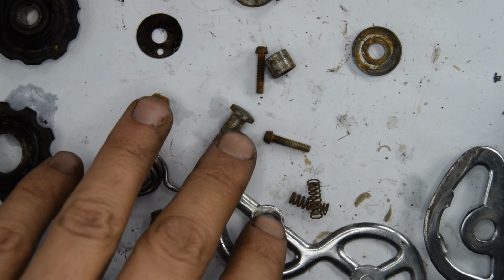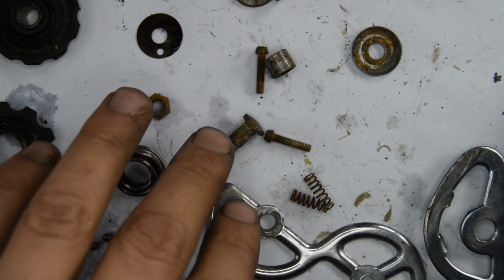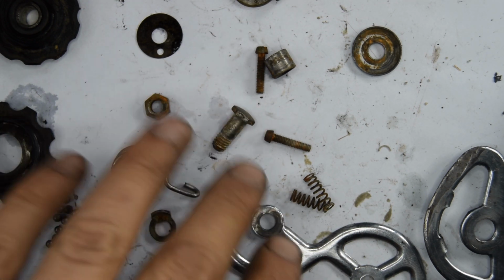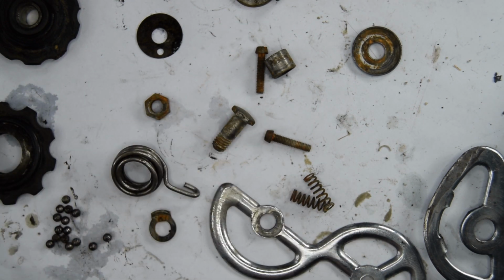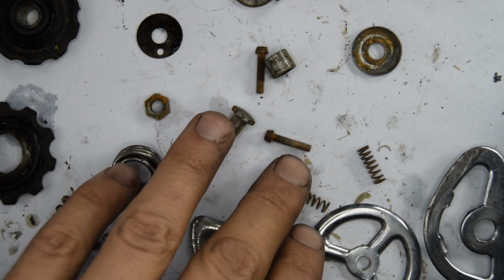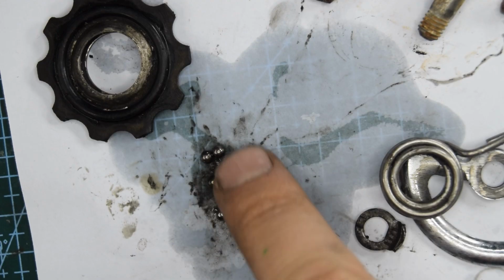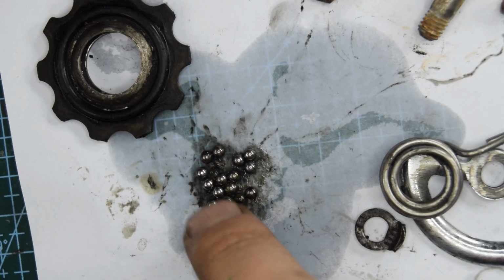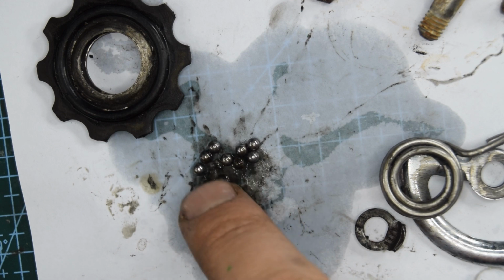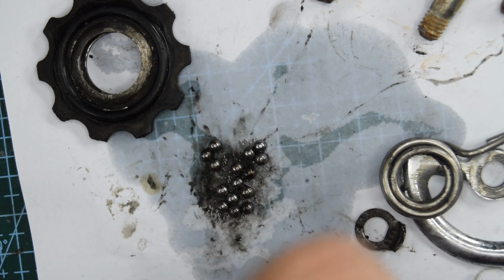All the parts have probably oxidized a little bit more now than they were initially, but that should be rectified. We're going to put a bit of grease on it. So let's finish this, and then I can finally put this back into the bike recyclery where I took it from. For the ball bearings inside the little pulley or jockey wheel, I've just quickly put some WD-40 to give them a good clean. That should do it, and the grease will sort out the rest.